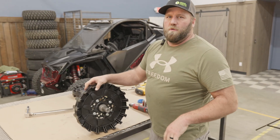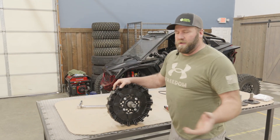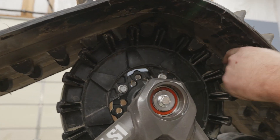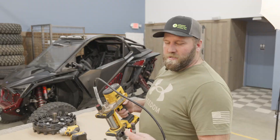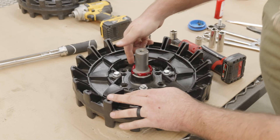If you're having trouble torquing those by yourself — obviously I'm a bigger guy so I can lean on it — but you can wait for that process when you get this track remounted with the hub in there. The track will hold tension so then you can go through and torque them. Now greasing the shaft — going to put some grease on and rub it in.